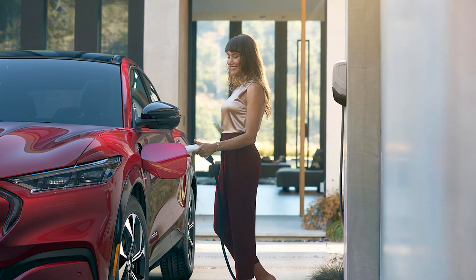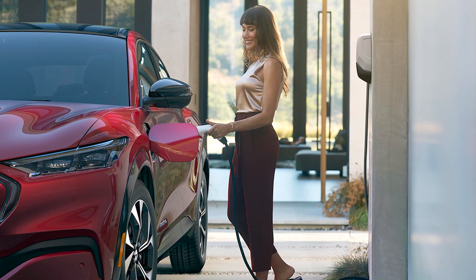No lithium battery is going to let you do that and still meet the rated charging rate. I could easily heat this battery up way more if I wanted to. If you wonder how warm batteries need to be, they need to be about the same temperature that people like — right around 75 degrees, that's kind of ideal. So all these people saying 40 degrees isn't that cold — well, 40 degrees, you try spending the night out there without any clothes on. 40 degrees is pretty chilly for a person, and it would be pretty chilly for a lithium-ion battery. This is not really an issue because people who own EVs are just going to plug it in. Maybe if you're a press person borrowing an EV to review, you don't keep it plugged in. But that's not how most EV owners are going to operate.